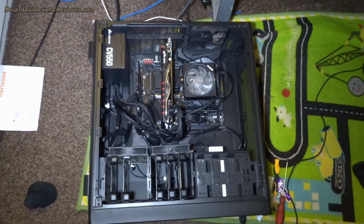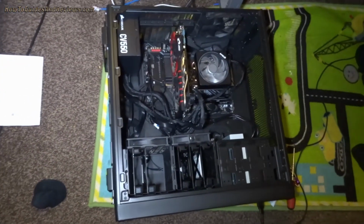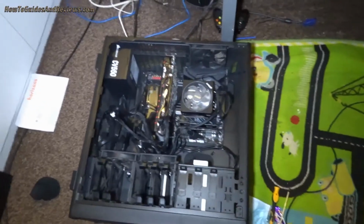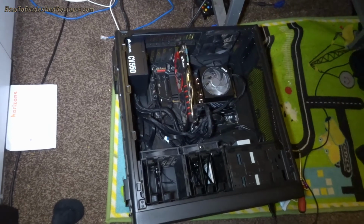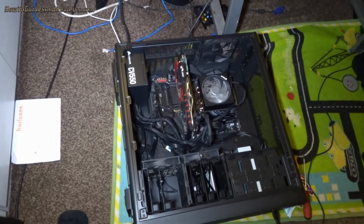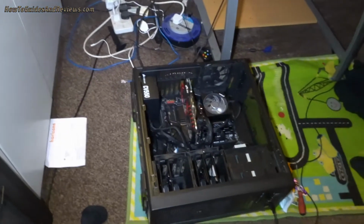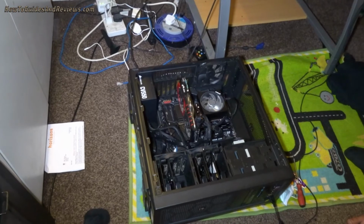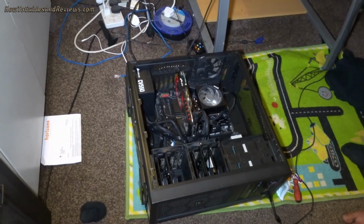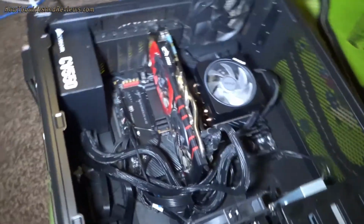MP600. Expensive, they don't last. Maybe it's the positioning under the cooler, GPU. But the temps were fine. 50 degrees. It was supposed to go up to 70, but it was around 48 to 52, which is fine for NVME2. Anyway, let's get it out of this system. Yeah, contact Scan Computers.